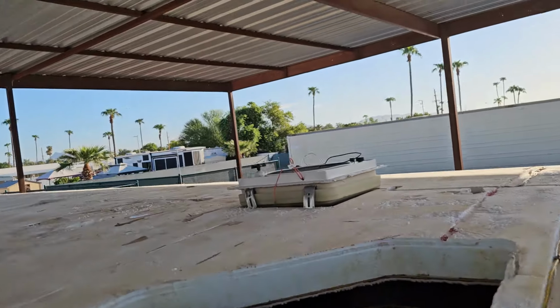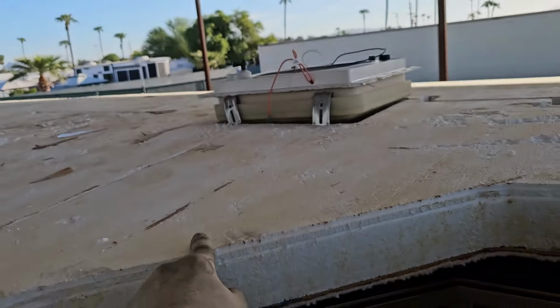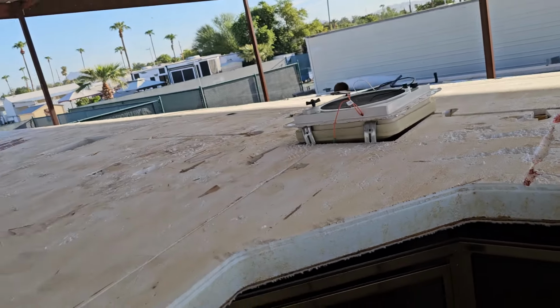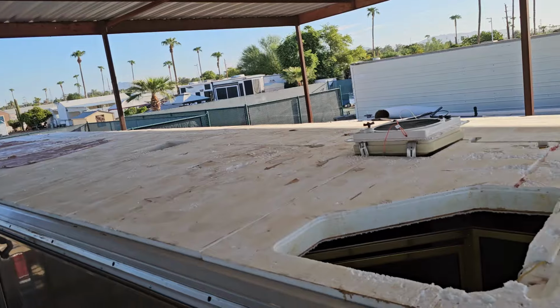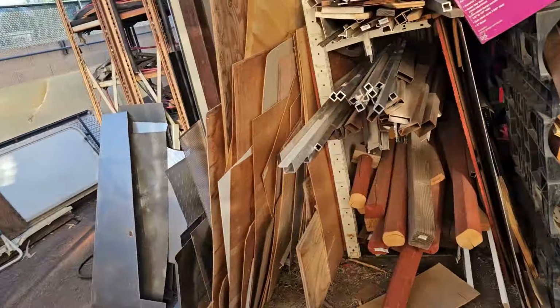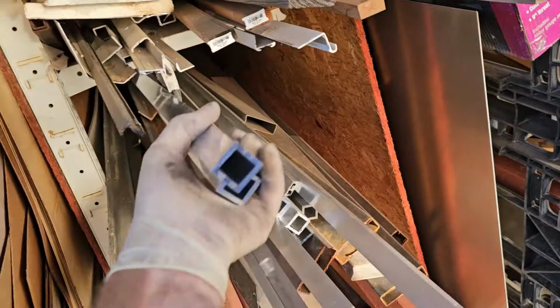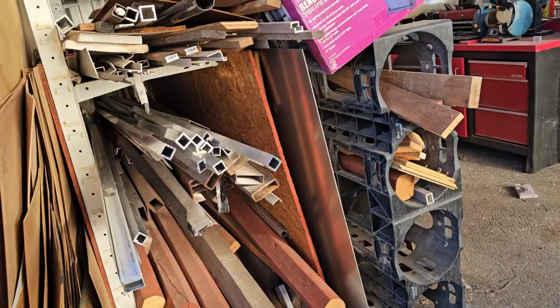And this crown that the Winnebago puts on is a very important structural part of the roof, because it is just laminated Luan, foam, Luan, Filon on top. They don't really have any structure in it. And if you let that crown sag a little bit, you're going to have to start adding structure like we're doing, using either steel or aluminum tubing, which we are getting pretty good at putting a bend on.